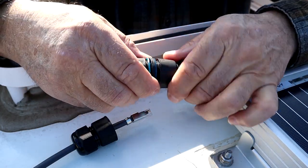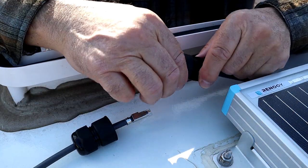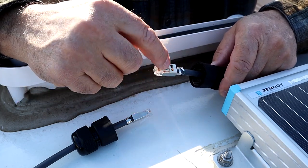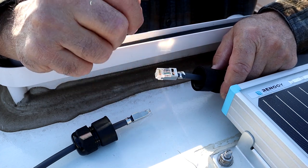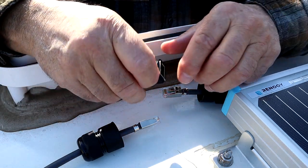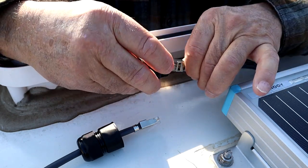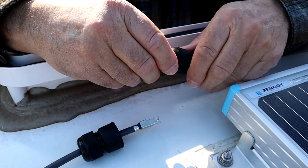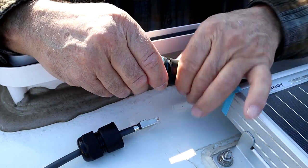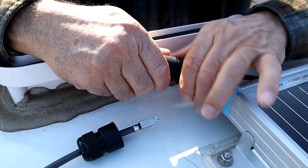This actually unscrews and comes in multiple pieces. What you see here are the back-end screw-on connectors on this cable — you put those on before you make the RJ45 connection here, and you do the same thing on this side. The piece in the center is the one that allows the pass-through from one cable to the next, so this will stay permanently installed here. There's a little blue gasket here which is part of the watertight seal, and this will stay on the roof.